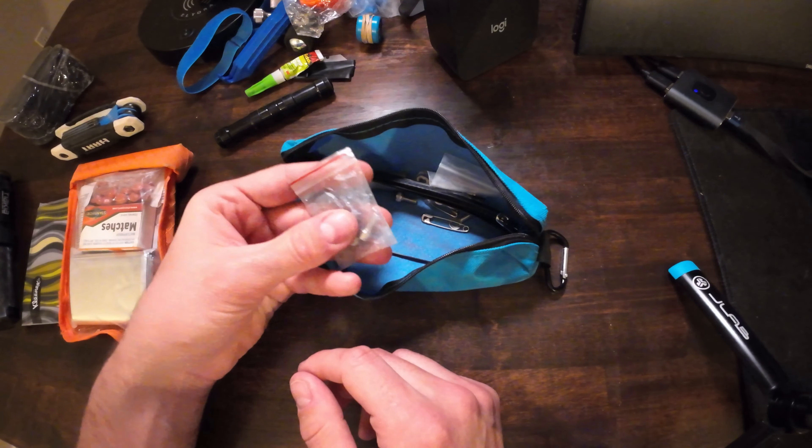One of the last and most important things is having a spare tube — even if you're running tubeless. You can mount it with straps on your frame to keep it out of the way, and forget about it until you get a pinch flat too big to hold air and need to go tubed. Make sure it's the right size; I run 2.8 up front and 2.6 in the back. A 2.6 tube will stretch to fit 2.8 or even 3-inch tires if needed.